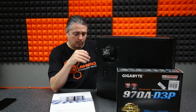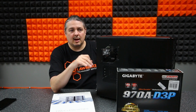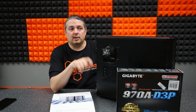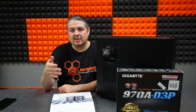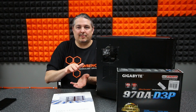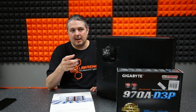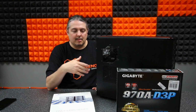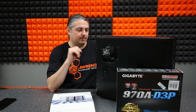Now, with FreeNAS, if you wanted to build something high performance, and maybe sometime I'll get around to building one like this, you can set SSDs in front of these, because these are only 5400 RPM drives. I highly recommend putting these in a RAID array, you can put basically caching drives in front of the other drives, so that gives it a high speed spot to write. And you can actually build a separate array of them, and those would write back there. Now the risk, of course, would be if in a power failure your cache drives haven't flushed out, and that's also why you would want them to be RAID. But those are real specific high-end configurations. For this one, like I said, we just went with those in the storage.